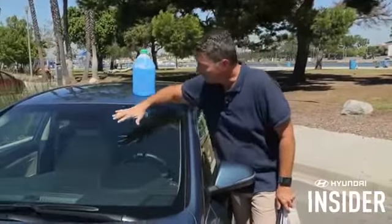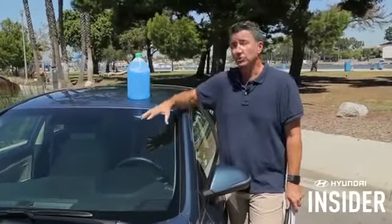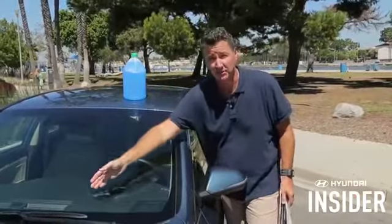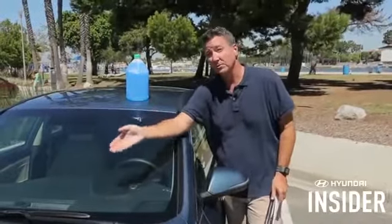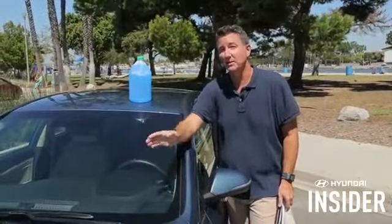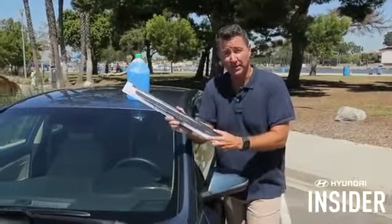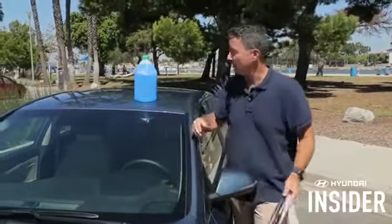Primary to your safety is visibility, so you want to make sure that your windshield is good and ready to go. First off, check it for any cracks, because when you get into cold weather, those cracks can grow quickly and really impact your safety. Also important is visibility from the windshield wipers — you're supposed to really check these things every six months, but we never do.